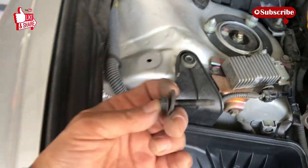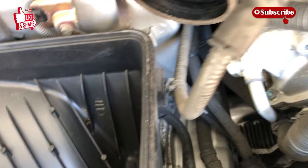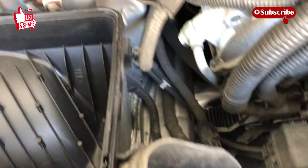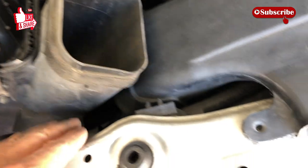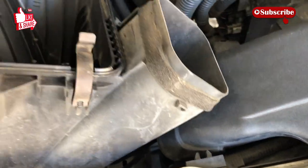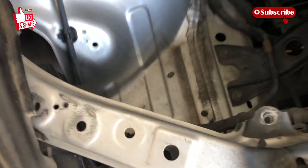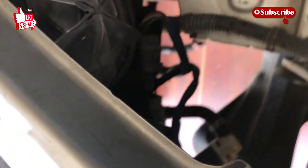There are long 10 millimeter bolts here. This clip wasn't coming out easily, but it turns out you don't need to take it out — just pull this section out and once that's done you can fold the air filter box up and out of the way. Now you have plenty of space to go in and access the headlight.